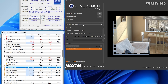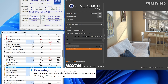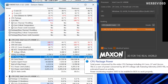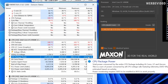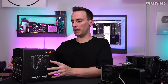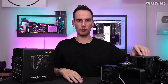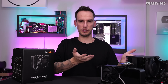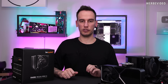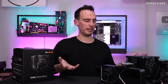I want to find out how much power the cooler can continuously dissipate, so I'll run the 30-minute Cinebench R23 loop and check after about 15 to 20 minutes. After almost 20 minutes we have an average of 272W that the Darkrock Pro 5 can continuously dissipate. I have to admit I'm impressed how spot-on the marketing is with the 270W TDP rating. Keep in mind the 14900K is rated at 125W TDP but typically consumes about twice that under full load — and the cooler can still handle it. At about 25°C room temperature, it might even reach 280–290W.